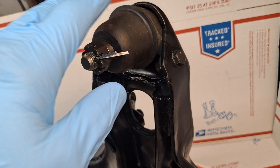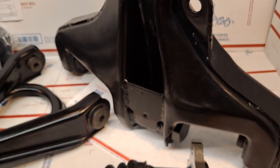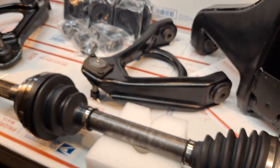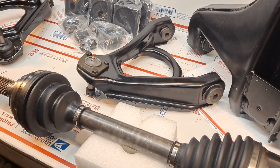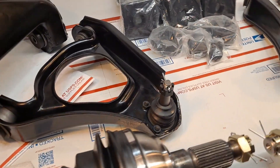And the corresponding ball joint. These ball joints have the correct taper for the '67 Eldorado, which is a one-year-only specific taper because of the one-year-specific knuckles used in 1967 for the all drum brake variant.